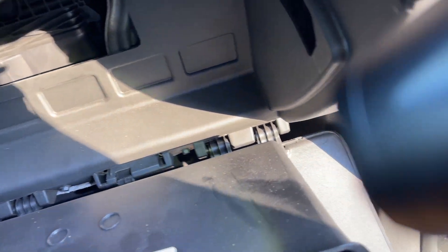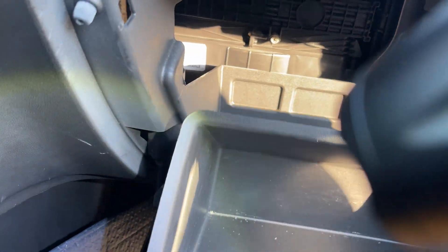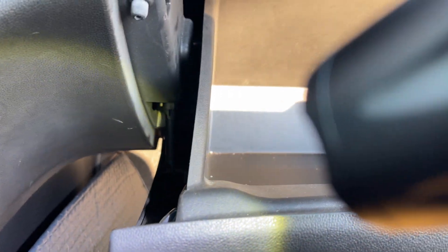Now to put your glove box back — with these little tabs, we're just gonna pull the glove box up and it should lock. Once it's locked into place, we're gonna put that little shock absorber through that metal piece on the bottom. It's just like a hook, so we just slide it over and press it in. There it goes, and that should be everything.